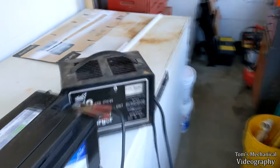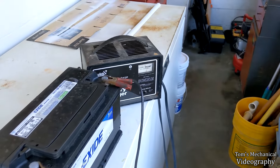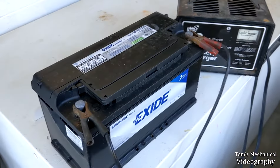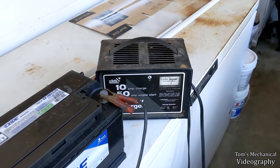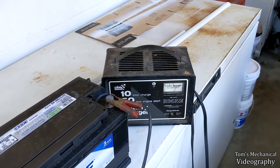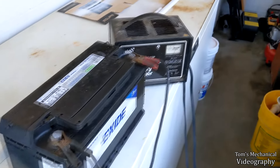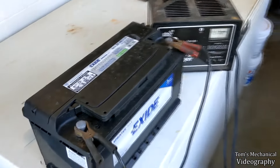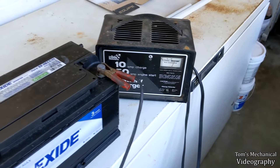If you hook up a battery and it just sits right there somewhere between 0 and 2, it's probably good. As you can see with this big old Group 49 out of the Olds over there, she's right dead. I had all the doors and windows open trying to evaporate out a bunch of the humidity and forgot about the trunk light and left it on overnight. She was at half a volt when I came back this morning. So the battery's still good — I was able to quickly put a little bit of a charge in it, throw it on there and get the starter to click. But she's dead. She's real dead. So I'm going to leave this charging for a long time.